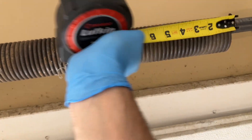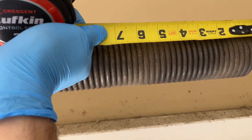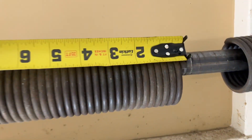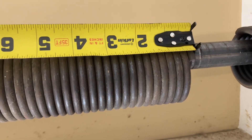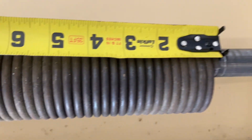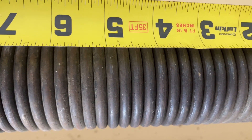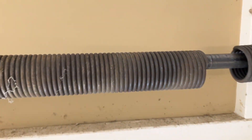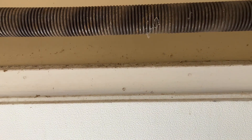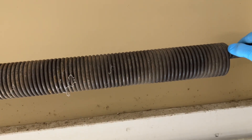I found a little cheat online to help with the coil wire size. If you have calipers or mics you can measure it directly, but if not, you can count off 20 coils and measure the length of those 20 coils. For me it came out to about five and a quarter inches. You take five and a quarter, divide by 20, and you end up with about 262 thousandths of an inch — that is the diameter of the wire in the coil.